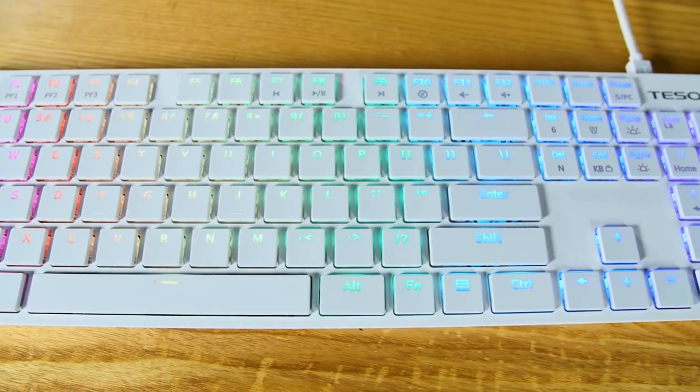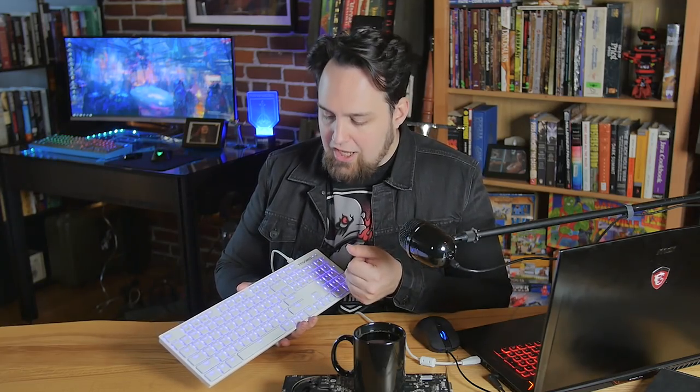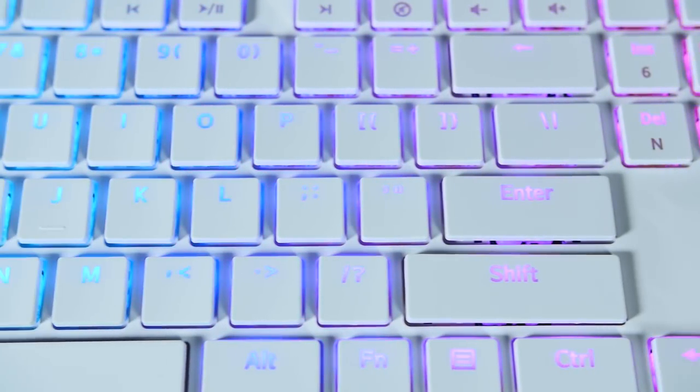These come in red or blue switches. The red are linear. The thing that's nice about red switches on this compared to a full-sized Cherry MX or Cherry MX clone switch is the travel distance. The actuation distance on this is 1.1 millimeter, give or take 0.4 millimeters — a little better than regular Cherry. It bottoms out quicker as well. It requires about the same amount of force, 45 grams. The blue requires 40 grams of force. Because it bottoms out quickly, it feels like it has better tactile feedback even though it doesn't — these are linear because they're red.